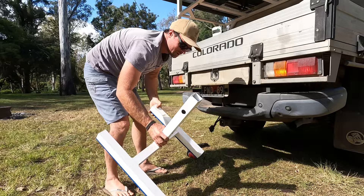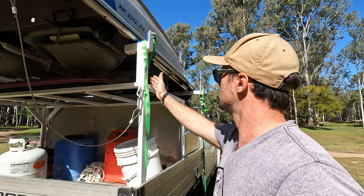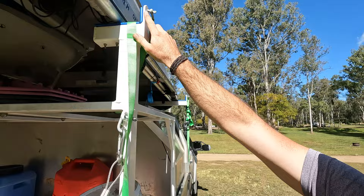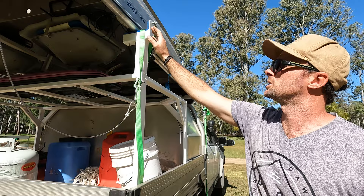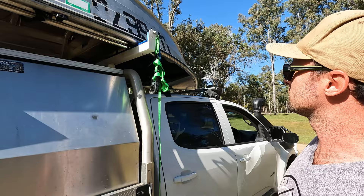This important piece stops the boat from hitting the vehicle — it goes into your tow tongue and the boat comes down along it. The frame is made from 25x50x2 for the bottom section. I already had this section from a cape trip, and just added 50x50x3 pieces. I cut the middle section out so we can leave the seats on. We're using Teflon sliders — you can use rollers, but the Teflon sliders work fine and it's easy to pull off backwards. There's probably only about 50 kilos on the back half and 50 on the front. I've made it higher than the roof to give clearance so it doesn't hit the Rhino racks when it comes down.